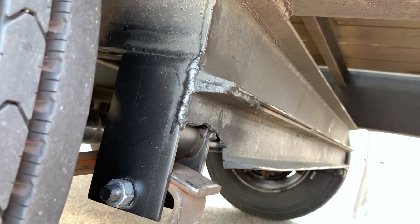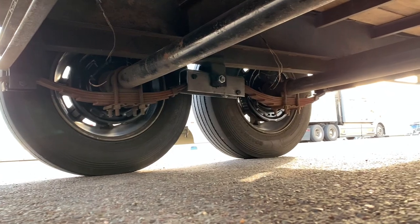I just finished filling up. Let me show you what they fixed on the trailer - it's really cool. You can see right there: four brand new brakes, four brand new backing plates. But the important part - the rear mounting brackets, or hanger brackets, that's what they're called - they were redesigned to now have a tube in there that's welded, instead of the old Dexter parts that had just a flat piece. I'm glad Dexter realized there was a problem and started making the hanger brackets to last a little longer.